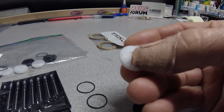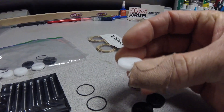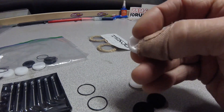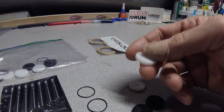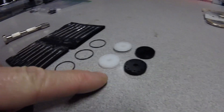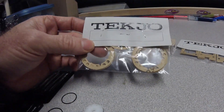These little slits here — if you face this piston downward, when you're coming back from your rebound, it forces oil into these slits, exerts just a little bit of pressure on the O-ring, and basically slows down that bounce when you're coming back up from a landing. We're probably going to end up going with a 1.4 hole in the front and probably close to a 1.3 in the rear.